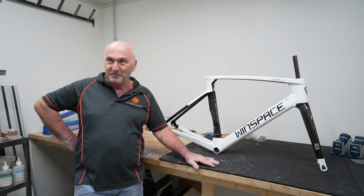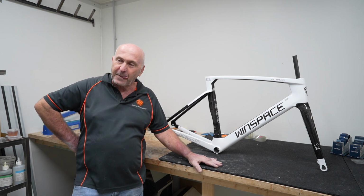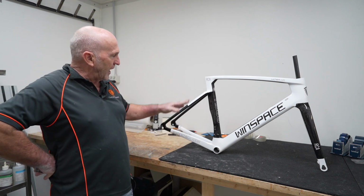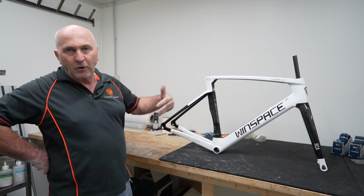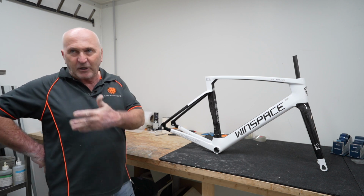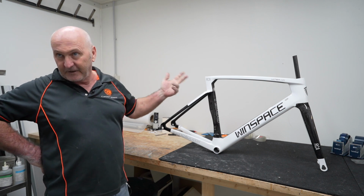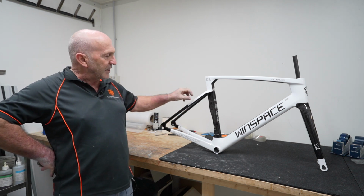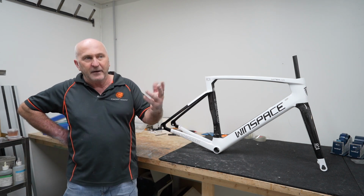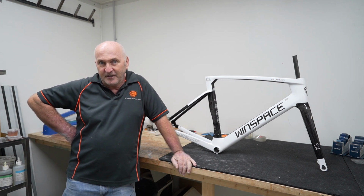As you saw, even somebody who's never seen anything like that can look at it and go, wow. Absolutely. So we'll put some images up on the screen, but what's it essentially doing? Essentially, through the carbon, we're looking at how the carbon transmits the heat. So if you've got a crack or something, it interrupts the thermal path. And as I said to you, you've got to put a heat load into it, and you've got to take a photo fairly smartly, because as the heat dissipates, so does the damage disappear. It all just becomes one as the heat spreads evenly throughout it. So that's the trick: instant heat, and get your photo quick.